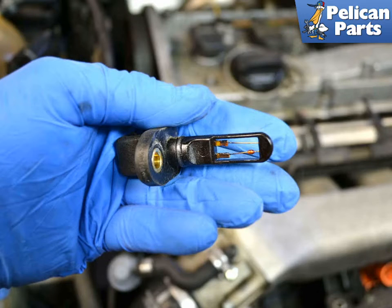You can now attempt to clean the sensor or replace it with a new one. The sensors develop an amber looking coating on them over time, which can harden to a glass-like coating. Carefully use MAF cleaner and some Q-tips to clean both wires. If you break any of the wires, you will need to replace the sensor.